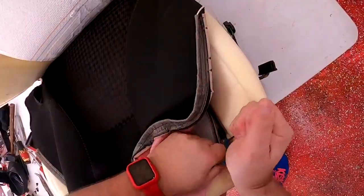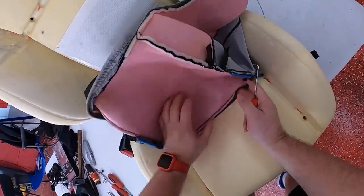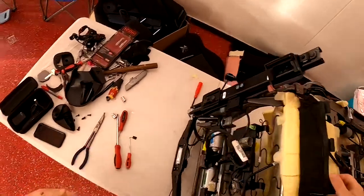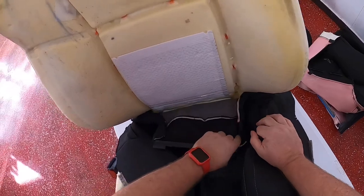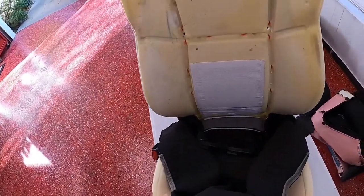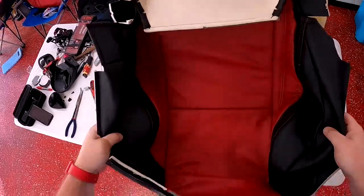You're left with just the clips, so use your little tool to get in there and undo them. Stick that clip right up underneath, give it a twist, and it'll spread just enough to get it out. Then flip the chair over — there are clips on the bottom holding that flap in. There's also a little strip of velcro, but once you do the clips and get the cross part, you can just slide it out just like the other side.